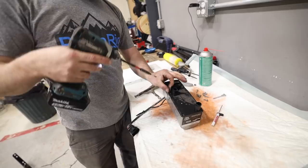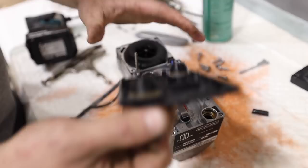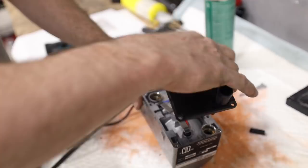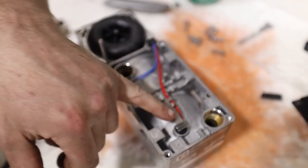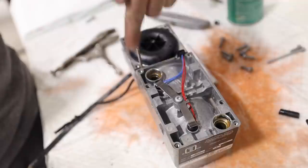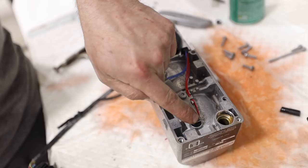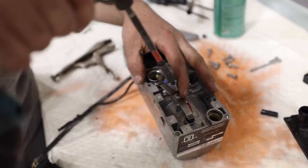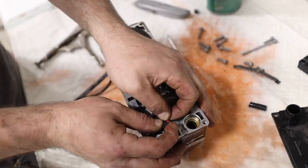Pop the covers off — just put your thumb on top and use your fingers to press. This cover just set it aside. The next cover pops off at the nipples — there's a little O-ring on each one that fits in a groove. Next, take off this little bar that holds down the two coolant temperature sensors. The cold glycol comes in this side — that's the blue sensor — and goes out where the red sensor is on the hot side; it basically spirals through the body of the heater. Take the two sensors out by wiggling them carefully with your fingers — don't just yank up on the wires. Now we're ready to split the body of the heater.